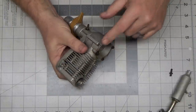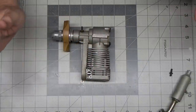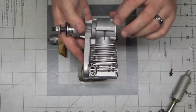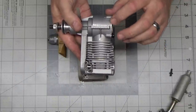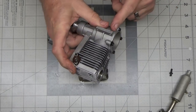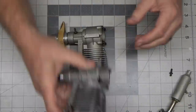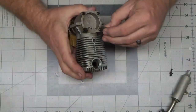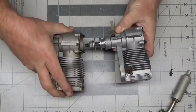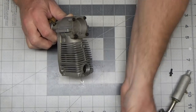I know that when I take the back cover off, I'm going to lose this gasket — pretty sure it's just going to get destroyed. But that's okay, because the same thing happened with the other engine and I just used Permatex Gray Motoseal 1 gasket maker, and it's never leaked at all. It's not a thickness requirement for spacing, it's basically just a seal, so I'll be okay using the Permatex Motoseal on this. You can also see the difference in the colors of these engines — this one I put through the ultrasonic and cleaned up real nice.